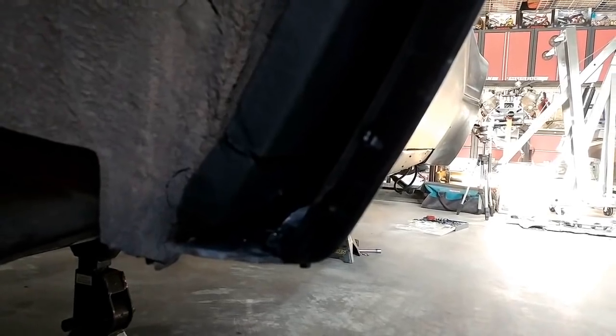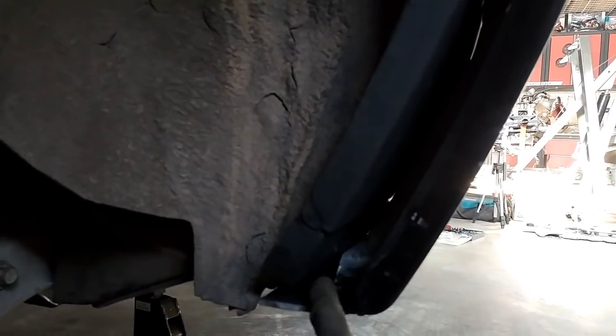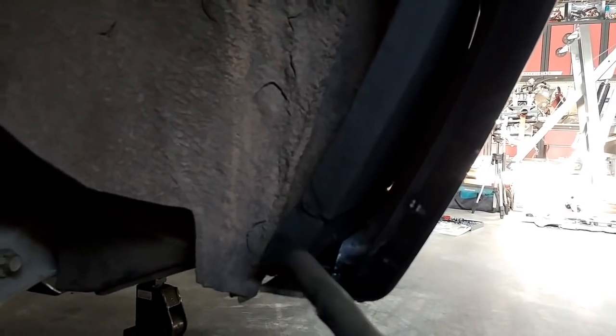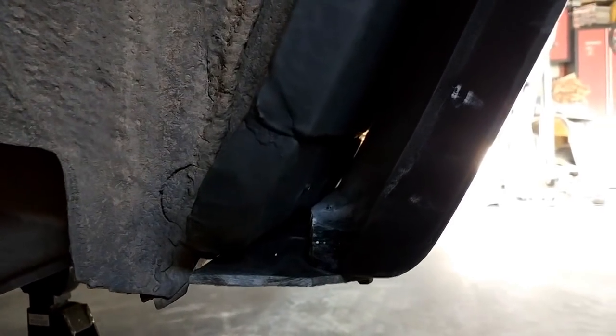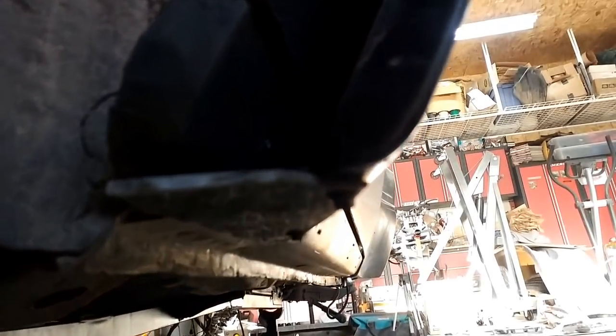Okay, so when I put all of the front fender together here, you remember I said in here I overcut this. And it's because this over fender came in and hit right on this edge. It was kind of curled up and in. Really couldn't get it to fit. So I ended up chopping it. You can see down in there the cut lines where I cut it. And I thought, oh man, this is overcut. What I ended up doing is taking this piece. This is literally the piece that I cut off. I took it, flipped it over, and then I put in 2 screws to hold it together.